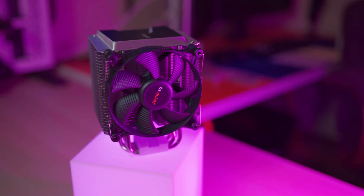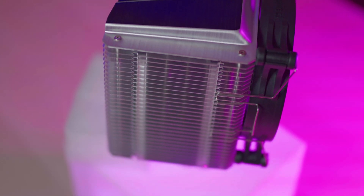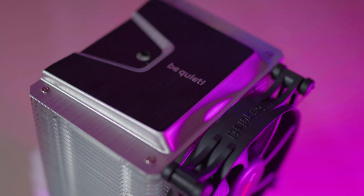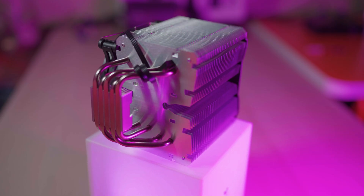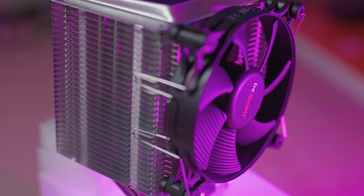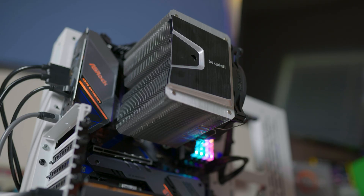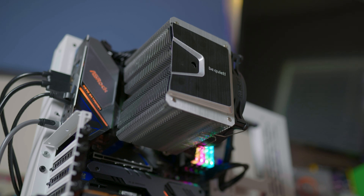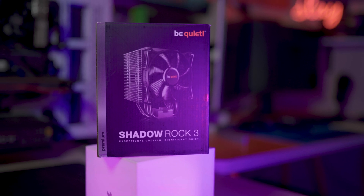What's really impressive here is at a $49 price tag, its TDP is set at 190 watts. This means it should be able to hang with my Ryzen 3900X and anything below that, and probably the 10700K and below on the Intel side. This is all achieved with five nickel-plated copper heat pipes and the surface area created by the large fins, and of course the Silent Wings 2 fan that can hit really high RPMs and keep everything nice and quiet. Be Quiet is one of those brands you can almost always trust to be at the best or right up there with the best in terms of low temperatures. That is just good engineering.